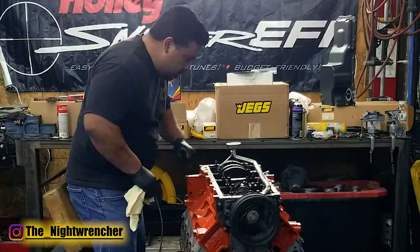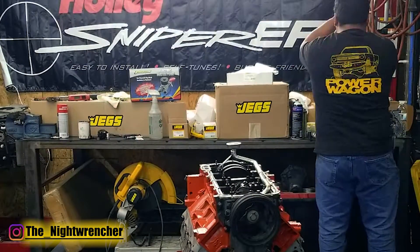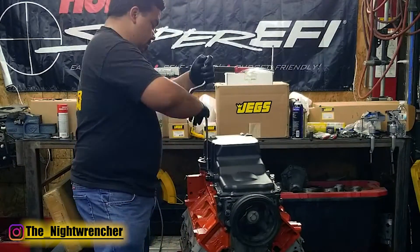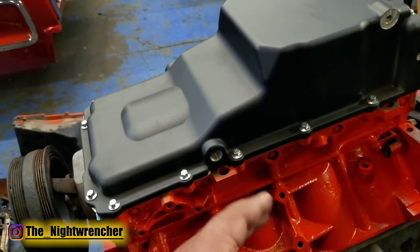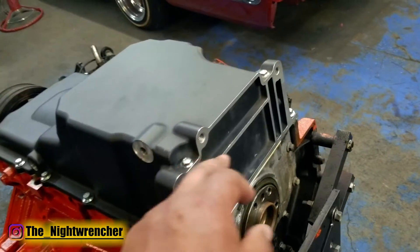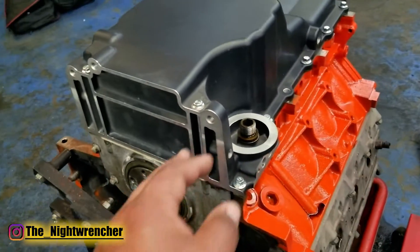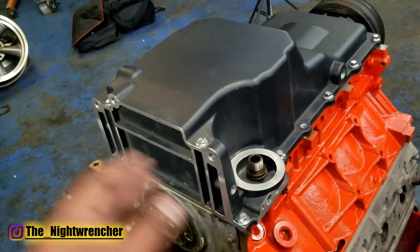I have the bottom of the block all dressed up. The oil pan kit actually came with brand new bolts so I didn't have to reuse the stock ones, and these have a wider flange head which is always nice. I went ahead and torqued all the bolts down because apparently there's an issue where if you over-torque these gaskets you tweak them and they end up leaking — you tighten them more and it seals up for a bit but then starts leaking again. The torque spec for all the shorter bolts was 18 foot-pounds, and the torque spec for the ones in the back was 102 inch-pounds, which is only about 10 foot-pounds.